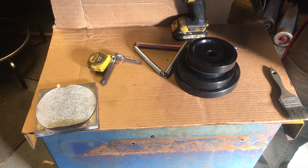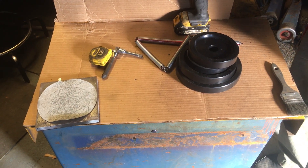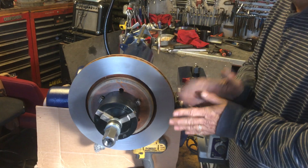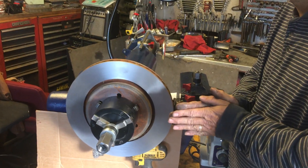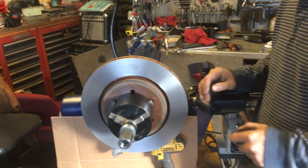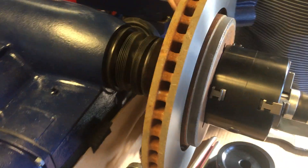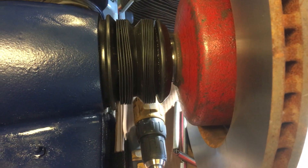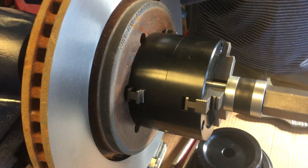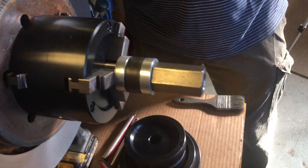Then adjust your belt speed to the slow speed and you're set. So that basically covers it. I can't stress this enough: the first cup is the whole story. You need a good clean arbor with a good clean flat true face, and you need a first cup that's true. Everything needs to be cleaned with a little bit of jiggle or wobble so that the shaft can do its thing. The shaft with the nut is only there to tighten your stack down against that face. We could get away with doing it the other way on little cars with little tiny rotors from days gone by, but now we're looking at 14, 15, 16 inch rotors — you're gonna have to step up your game for that. Thank you for your time. I hope this helps everybody with their machines making money — that's what we're here to do. Good luck to y'all.